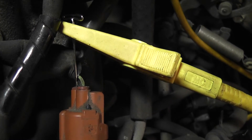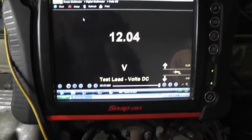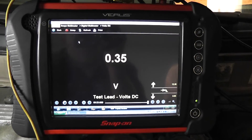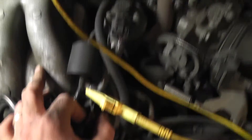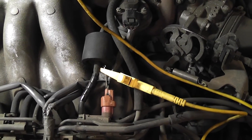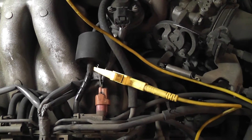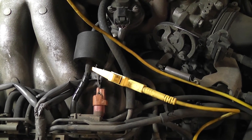Got the T-pin back in the bottom wire. Take a look at our voltmeter — we're at 12 volts. This is with it plugged in. I'm going to reach down and unplug the solenoid, and you'll see that dropped to zero unplugged. Solenoid unplugged — plug it back in, goes to 12; unplug it, drops to zero.